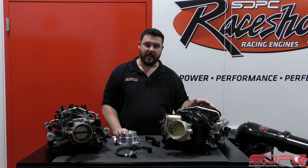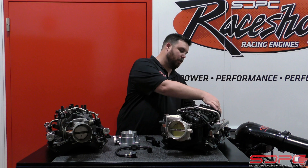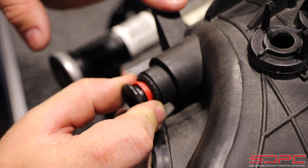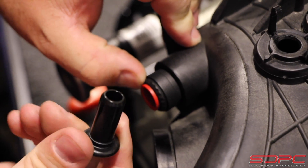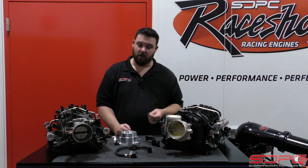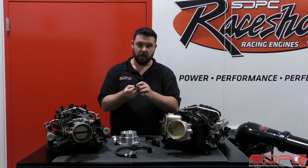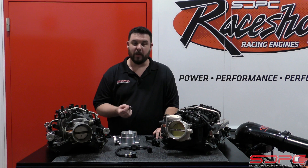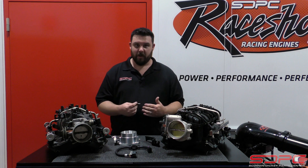Next is the vacuum hose on the back of the intake for your power brakes. Sometimes you'll find some of these intakes like I did, and it actually has a little plug in place of that hole in the back. Now don't try to force these plugs out. There's actually a little red ring retainer here that you just press back with either a screwdriver or your fingernail, and you gently pull these out. Please don't make the same mistake I did — I actually forcibly pulled one out with a pair of pliers. What happens is the teeth inside that retain this little plastic plug are made of metal. They'll gouge hard right there on the surface and it will not seal on the O-ring inside. I chased a vacuum leak for two weeks until I finally figured out it was something I had done.